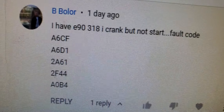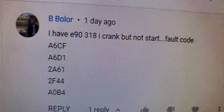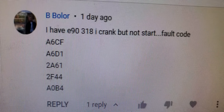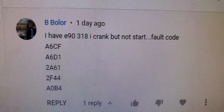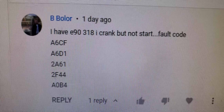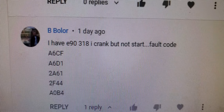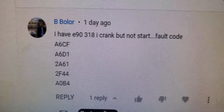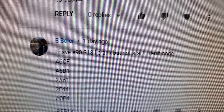The first code is A6CF. This is for a sensor located under the hood, sitting in front of the cabin filter. The cabin filter cleans the air when you run the AC. There is a button with a recycling light or regular fresh air setting. When the sensor malfunctions it will give you this code. The sensor's job is to detect pollution in the outside air.